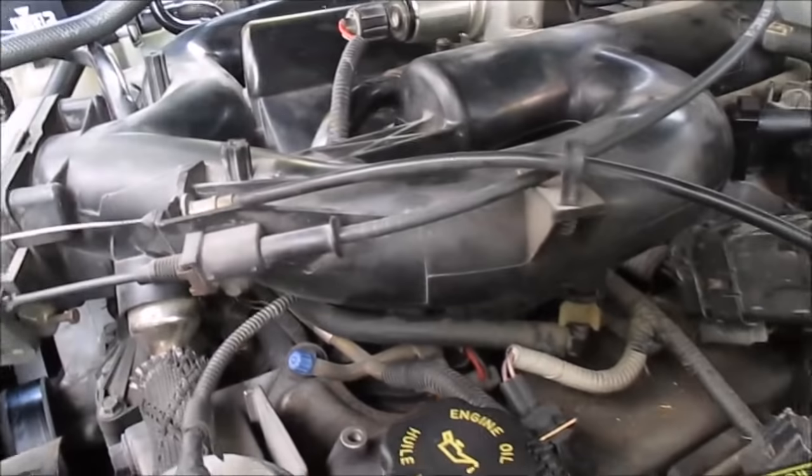Just another way to show you guys — I built something and I think it works, and that's good enough for me to call it. I think I've got to replace — give me some new intake gaskets. You can see when it was leaking from the hose it popped out real clearly. I saw most of my leaks down in here, down at the bottom and down on that side, both sides. So, got an intake gasket leaking — which is actually pretty common on these. That's it. Not too bad — I'm happy.